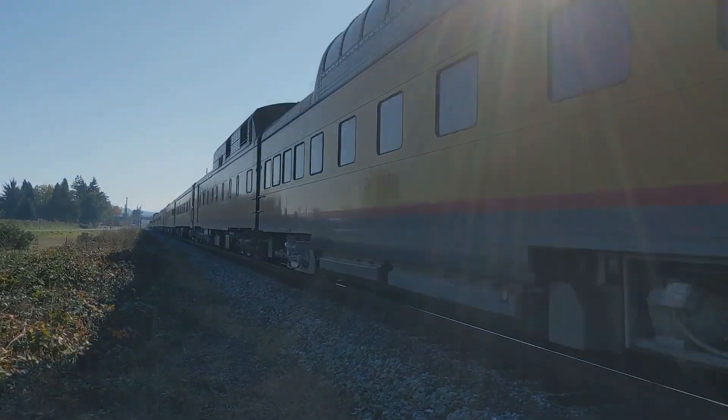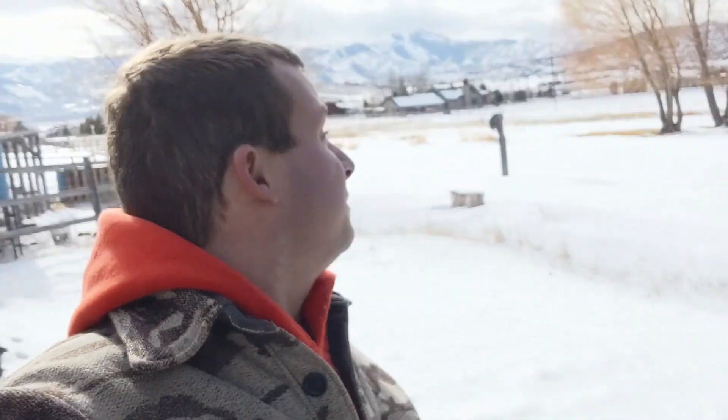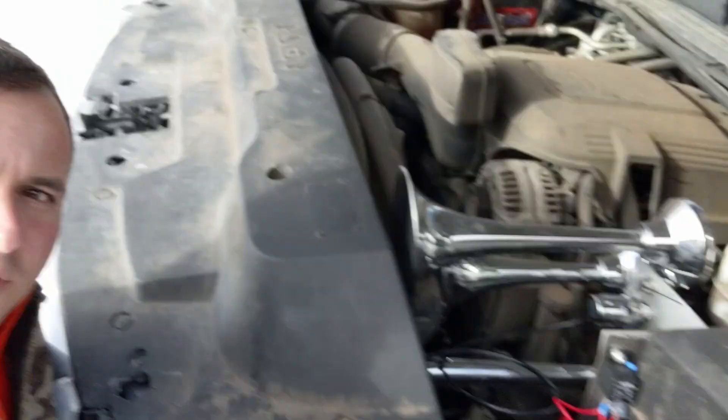After that defeat we called it a day, ordered replacement parts, and they arrived about a week later. We're back — I've got the replacement compressor and tank, and it's a nicer day. We're going to pull the old tank and compressor out and put the new one in, leaving the wiring so it swaps right in. I also ordered a new solenoid, but first we'll take the old one out and see if there's just something bound up in there.